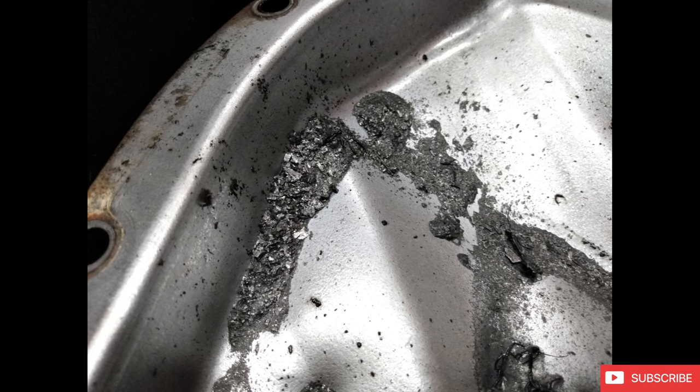I would caution against using the tubular up and forward header type turbo manifolds. I've really only heard horror stories about those things cracking and being generally bulky and big, making it tough to access spark plugs. Plenty of room for the manifold, the turbo, etc. I did have to relocate my coolant reservoir there in the passenger wheel well. But plenty of room for a 3-inch downpipe, which was plenty for me at the time.